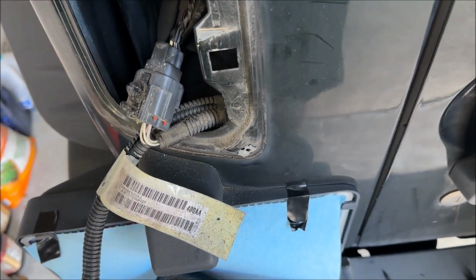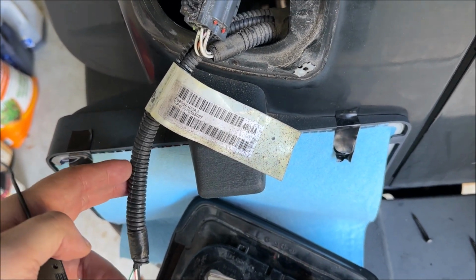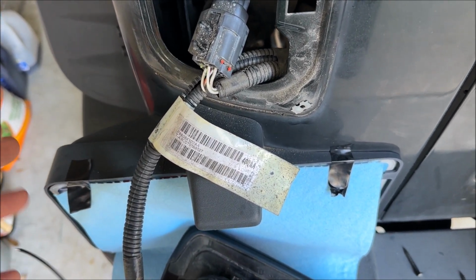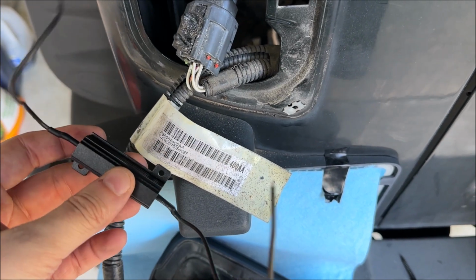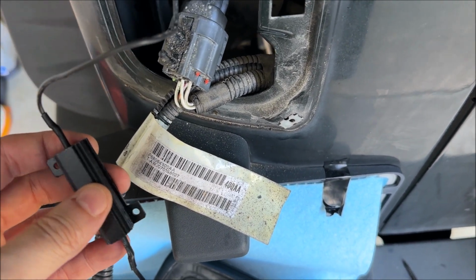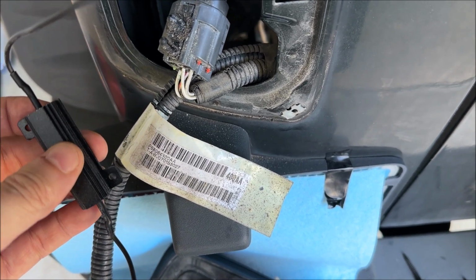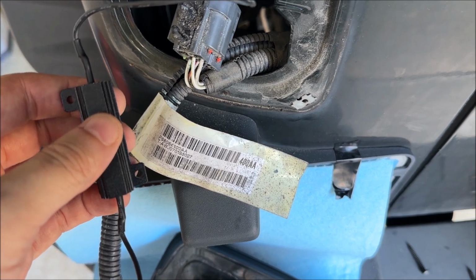So the reason for that hyper flash is because the LEDs are not drawing enough power load from the harness, and so the Jeep is sensing that, and it's thinking that the tail light, the brake light, is out, and it's a good warning to let you know that you need to replace the brake light on whichever side is having the problem. Putting LEDs in the front won't cause the problem. Putting LEDs in the back will. And the way you resolve that is installing a load resistor on that brake light turn signal bulb path, and that will add extra resistance, extra load, and then it'll put back at the level the Jeep expects for these bulbs. And so the alarm will work. If the bulb does go out, you should get that alarm again, because you won't be getting any power draw down that line. But load resistor is what you need if you want to stop the hyper flash and stop those annoying alert messages.